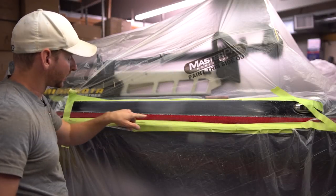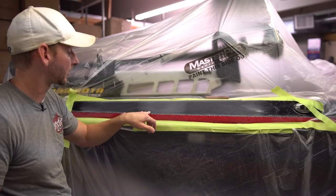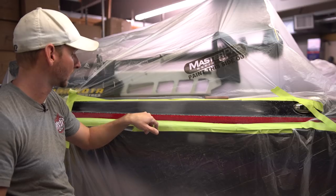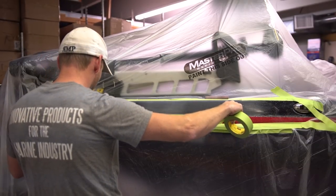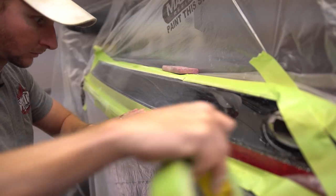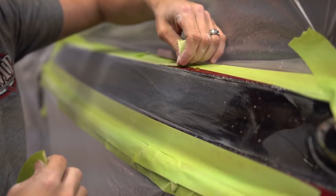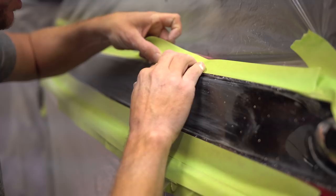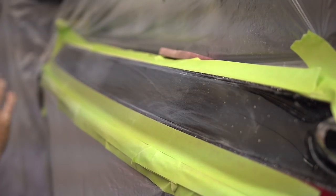Now that we've got this area roughed up, I'm going to run a tape line where the red meets the silver, leaving the silver exposed. That's where we're going to clear to — we'll do the black metal flake to where it meets the silver, and then clear all the way down to where the red and silver metal flake meet. It's very critical that you get this tape line perfect. Same thing up top — we'll run our tape lines where the red meets the silver metal flake, which is where we're going to clear to. Now I've got to come back in and rough up where the black and silver meet again using 400 grit sandpaper.